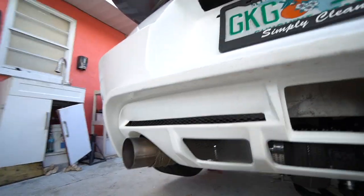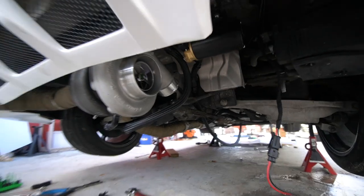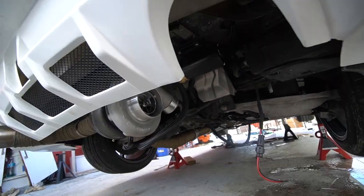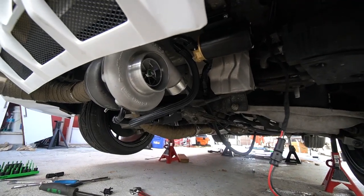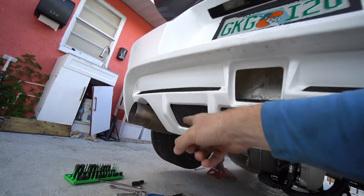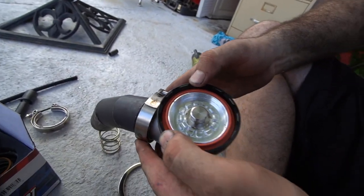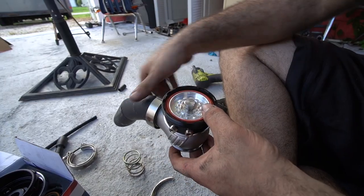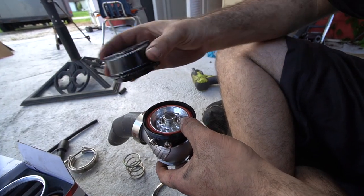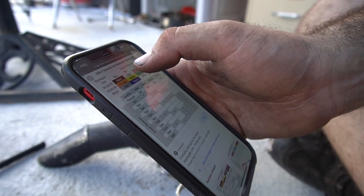The oil part is done — look at that tip. All oil lines are done. We've got one pipe left and the wastegate. This is the diaphragm: pressure goes through here or here. Pressure in the top portion with the spring pushes back down, shuts it, which makes more boost. We're going with a green spring plus yellow spring — so 3 plus 7, that's 10 pounds combined spring pressure. Inner, middle, outer.